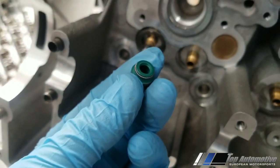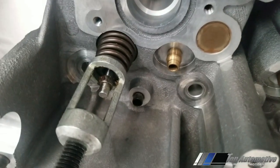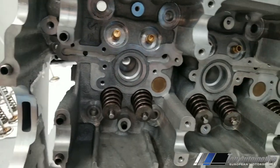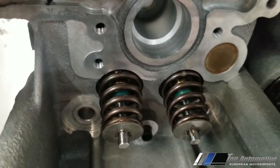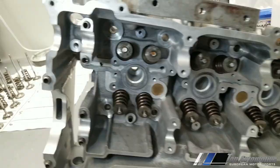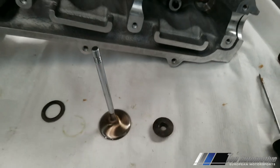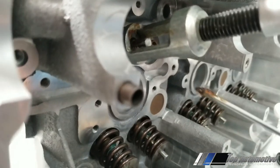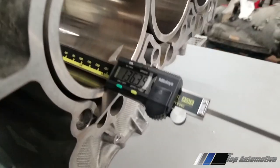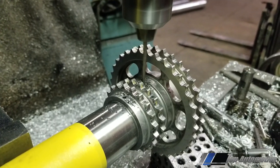Just like that — here's our valve stem, this is how you want them seated. This is our keeper, fully seated. Exhaust valves are all installed with brand new valve stem seals, fully seated. We've completed cylinder head bank one and are now moving to bank two. Most of the intake valves are installed — getting some grease to insert the keepers, then we'll finish off bank two.